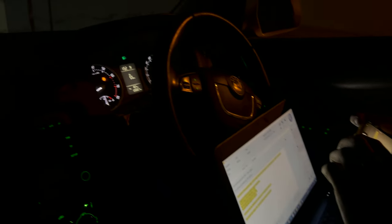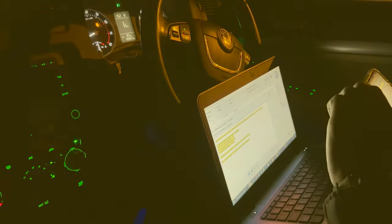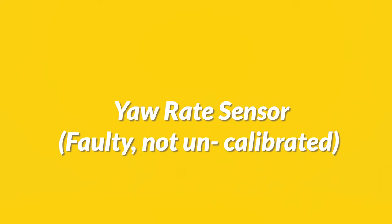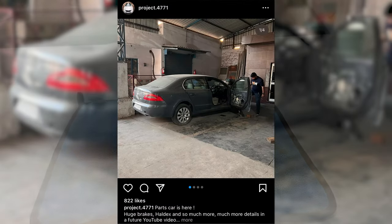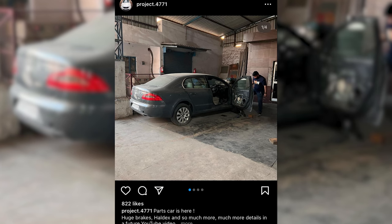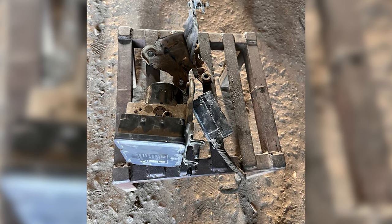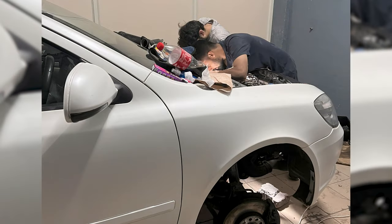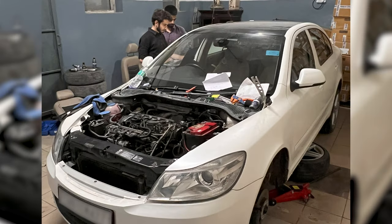After the brake lines were put back on, I gave the car power to check if the ABS unit would accept the new coding. It was working just fine, but it had a fault of the yaw rate sensor being faulty, which indicated that the ABS unit I used out of the donor car — a Superb VR6 — was itself faulty. So after a quick visit to the scrapyard, I picked up another ABS unit out of a newer 2-litre TDI Jetta, which connected, accepted the coding, and showed errors that would have been erased by doing basic settings for the ABS.